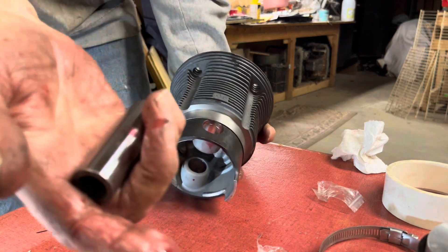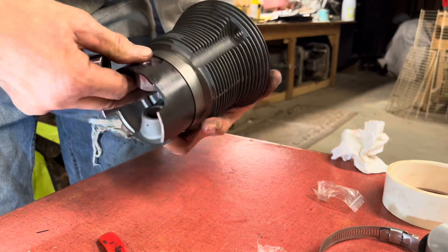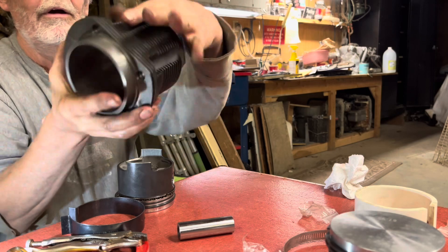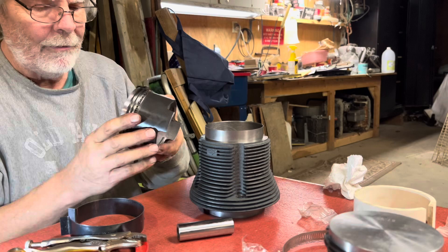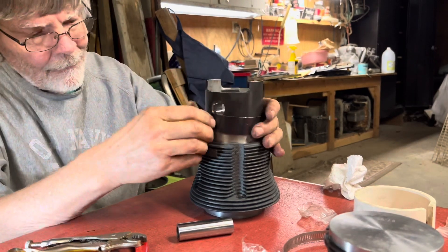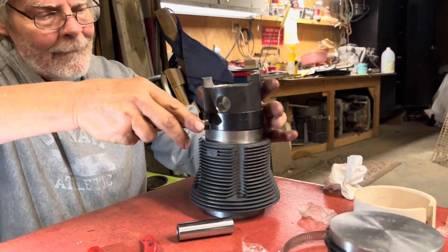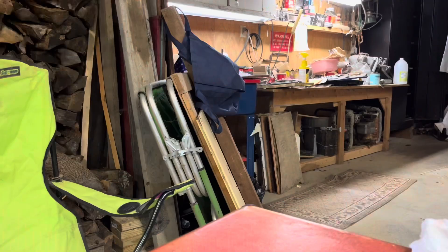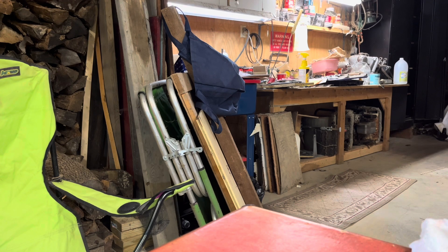Here's the technique: we're going to assemble this on the bench and push the ring up into the cylinder like that. Once again being mindful of how this is going to go into the motor — flat side needs to be here, arrow needs to go that way. There's your arrow. This piston should slide right in. There's a lot of tedious work here.